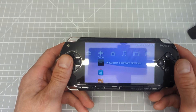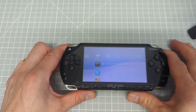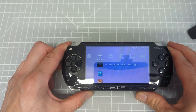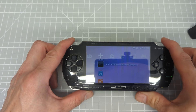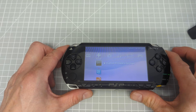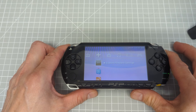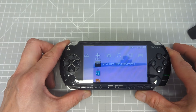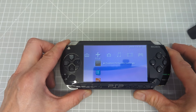If you've gone through all of these various options and you still have a black screen, well, there's probably something more deeply wrong with your system. We're not able to reboot into the lower level layers of the operating system, so there's obviously something going on with your console — either some sort of hardware fault or some sort of deep corruption issue. At that point you are going to need some professional help to try and recover it. But hopefully if you've got just a normal something-has-gone-wrong, or a plugin not playing correctly or something like that, this should let you get back into your system, recover it, and get back on playing with your games.